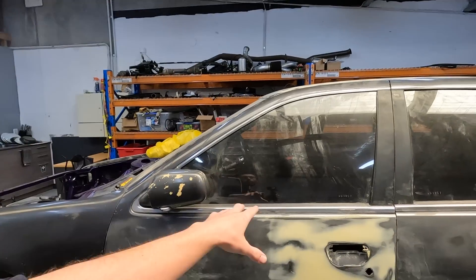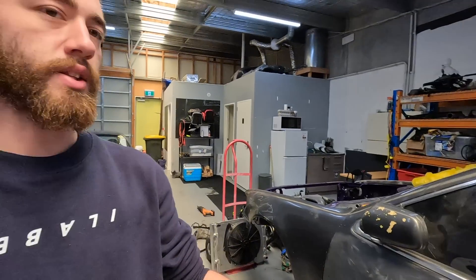We are going to be painting the car the same colour as the engine bay - I am absolutely in love with this purple. It's a Ford Falcon purple but it's got a little bit of silver and a metallic additive that makes the colour pop in sunlight. It's also going to get fully rewired. My initial plan for it was to make a simple seat-time drift car and we ripped all the old body loom out, so that still needs to be wired up. We're going to keep it pretty basic - just rear brake lights, fuel pump, and the front windows. Whoever wins this car could put it back on the road as the shell is straight; you'll just have to do a little bit more wiring for things like indicators, cluster, and headlights.